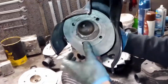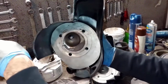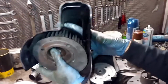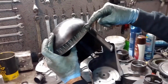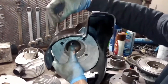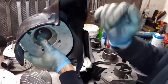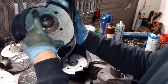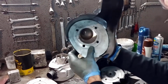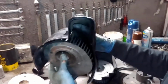That is, in the end, the fins are vertical, so they obstruct the passage of air in a lateral direction, that is, to then exploit what the air would do, according to the designer's idea. It passes over the fins and is blown out by this exit. However, how would the air reach and make the best use of the radiant surface of the side fins? It does little, because there is little space left, so a lot of air passes through the central fins and in the side fins, above all in the part, let's say, towards the Vespa frame, there is little air passage. So, this is a problem. Later we'll see how we can solve it.